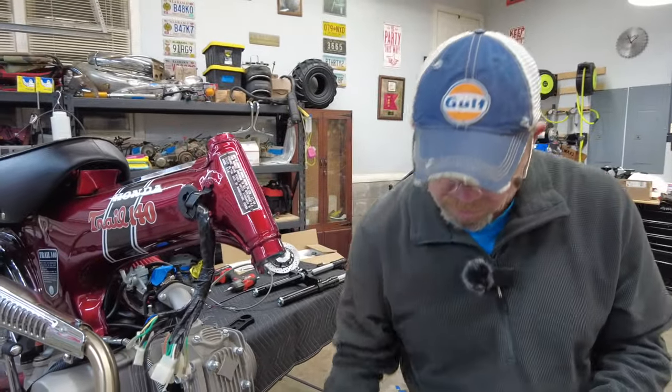Now let's assemble the front hub and wheel assembly. I'm grabbing the front rim and tire — this is a 12-inch aluminum rim from my previous setup. We need to flip that brake rotor around first. Using the 6mm hex, this is straightforward — three bolts, pop them out, flip it over, put it back together. Notice how tight things aren't from the factory — you need to be aware of that when you get your kit and go through and check everything.